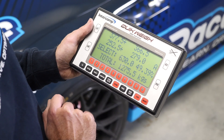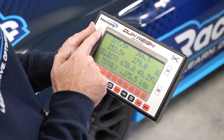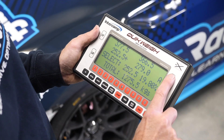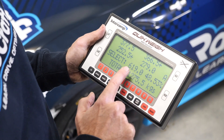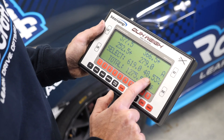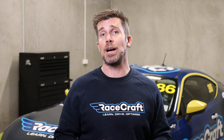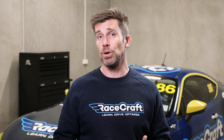If we want to display the cross weight we can click on the left front button to remove that, click on the right front button to add it in, and we now have our total cross weight as well as this being displayed as a percentage. There's nothing particularly tricky about setting up and configuring your scales, but following through the steps presented in this module will give you the best chance of success as we move into actually making your corner weight adjustments.